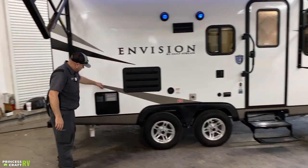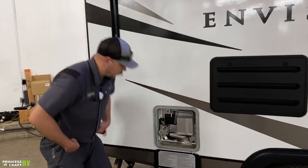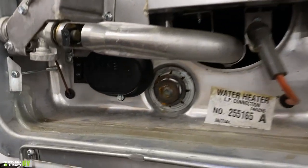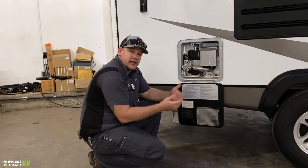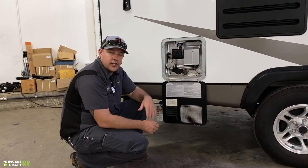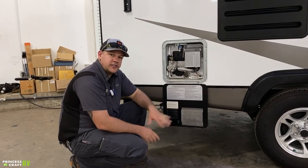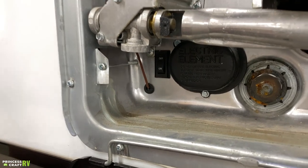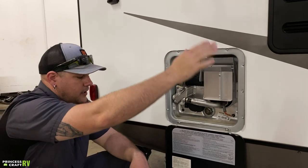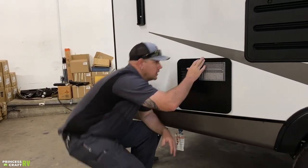This has a six-gallon water heater with a gas/electric option — you can run on LP gas, 110 electric, or both for faster recovery. The anode rod slash drain plug is dead center at the bottom. Replace the anode rod as it wears out; when you drain it, inspect it and rinse the inside of the water heater to clear debris. When about 50% of the skinny rod in the middle is exposed, it's time to replace the anode. The on/off switch for the 110 heating element is in the bottom left corner. Inspect the burn chamber for insect nests that could affect gas operation — insect screens are available to cover these vents.